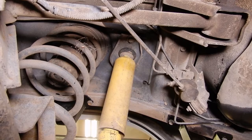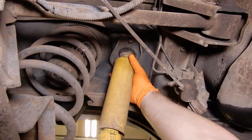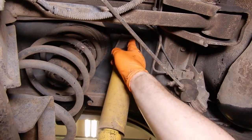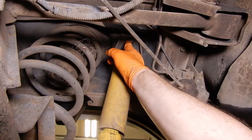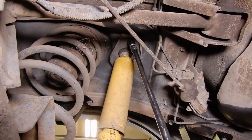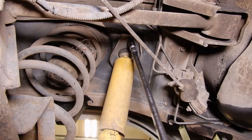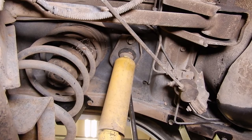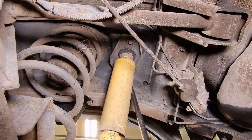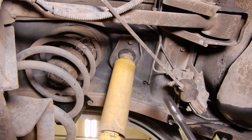We're back now and we're under the truck. The next step is to remove the original shocks. There are two bolts that hold this shock mounting flange on. You really want to soak these with penetrating oil before you try to take them out, because if you break them off it's not fun at all to remove them. We use a really long extension with a 14mm and get up there. These have been soaking for a couple of days so they'll come out pretty easily. I kind of bounce back and forth between the two and loosen them evenly, because as you loosen them you're actually lowering the axle down, and when they pop free the axle is going to jump as the shock falls down — so just be aware of that.